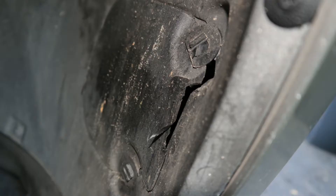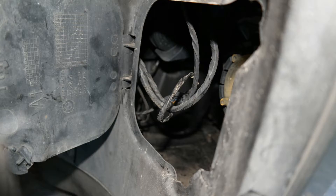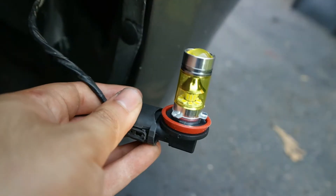As you can see in the photo, there is a little cover that gives you access to the fog lights and there's another one on top of it that lets you access the headlights. All you have to do is turn the wheel on your car in a direction that makes it easy to access, then unscrew those little screw things — or you can pop it off with a flathead screwdriver. Once inside, you'll find that the original fog light is just plugged in, and you simply twist it left or right until it comes out.